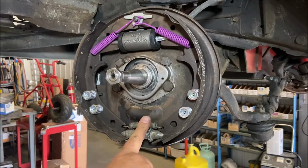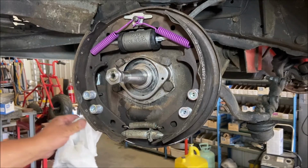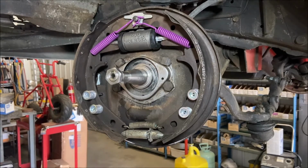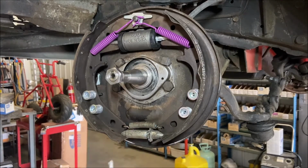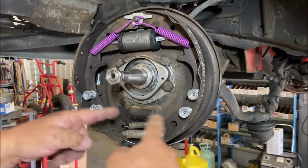That's not a lot of tension on that, but the drums are at their maximum. They're 70 thousandths above their maximum, so I'm gonna have to turn this out a lot so that this will lengthen and then the spring will be tighter.